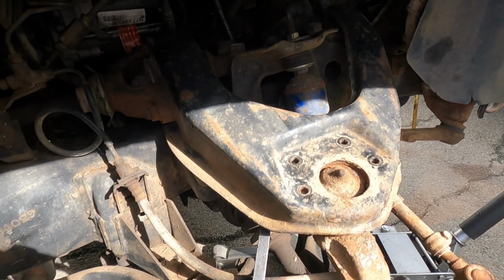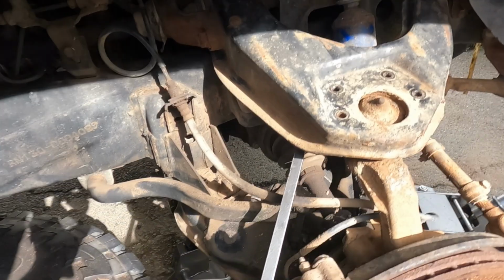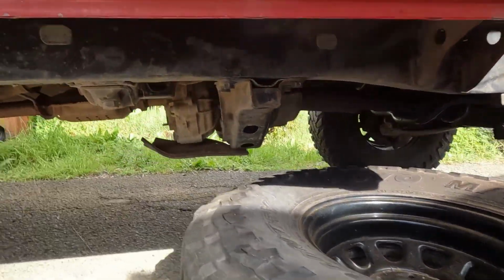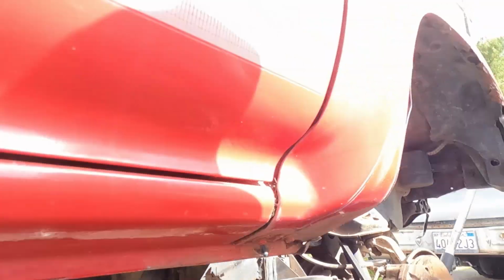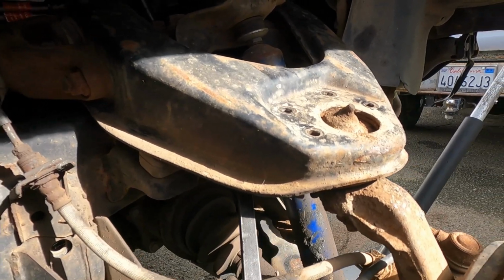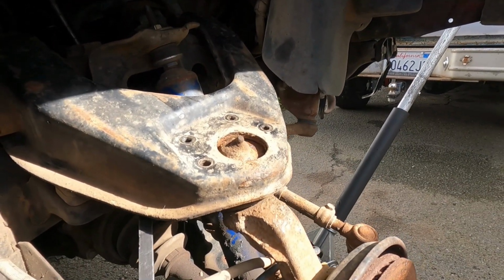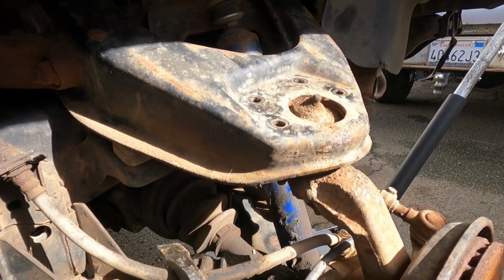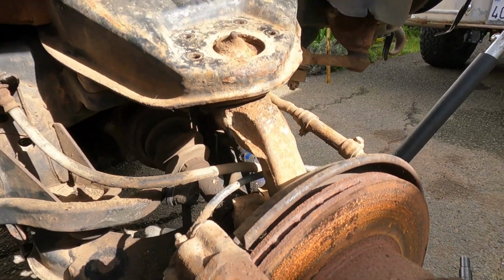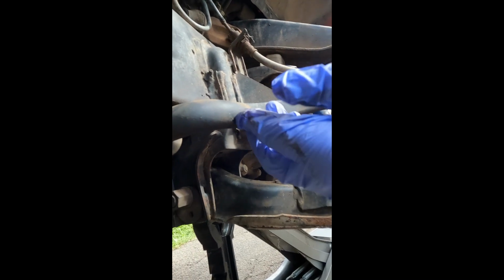Alright, so my truck already had the torsion bars cranked. So I went ahead and loosened the torsion bolt. This guy. 12 turns. Just enough to where the bolt doesn't come off the top, and now I'm able to move this a little bit better. Before that it was solid, so yeah, drop this down, get this block in. While we're at it, quick little sway bar delete there, bud. Get this girl flexy. All right, pop it the other side and then back to business.